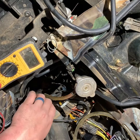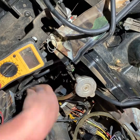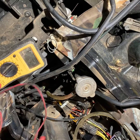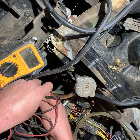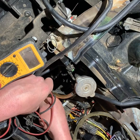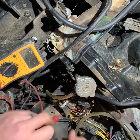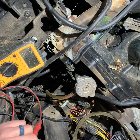I'm going to show you how to test to see if your temperature sensor is not working. Here's my lead right down in here that goes to my temperature sensor. What you do is get it up to temperature where the fan should be running, and then take a multimeter and go between the two terminals inside the connector. If I had it up to temperature, it would be ringing, showing that I had continuity between the terminals on the sensor. And that's how you would test that.